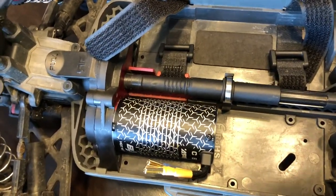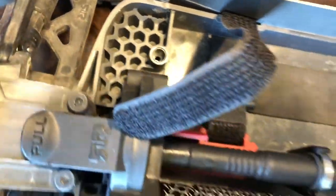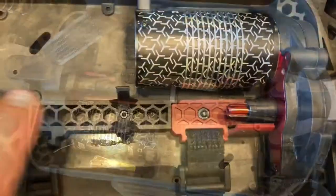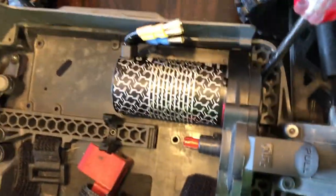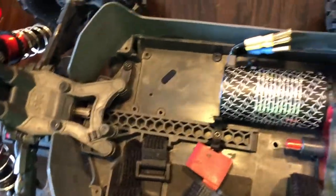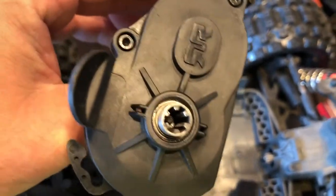I'm going to pull this motor out - just kind of pry a flat head screwdriver back there while lifting up on that tab and work it from each side. It shimmies right out of there. You got to pull the drive shaft first but we'll get to that. The red block's got to come out of there first. That screw there and it just kind of slides down and out of the way, and then this module can come right out. Just stick a screwdriver, work it from each side, and that'll eventually come out. It is kind of tight if there's any dirt in there.